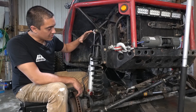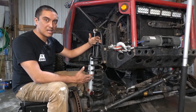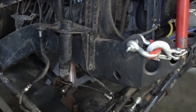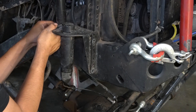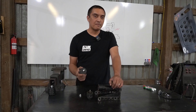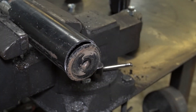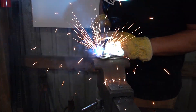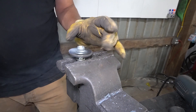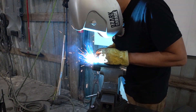We're going to lower the coil mount on the frame. On the front, it's a relatively simple operation because when I built these mounts, I made them adjustable. All you have to do is unbolt this and lower it one bolt hole and it'll actually be one inch lower and raise the vehicle one inch more. If you buy a set of Perry Parts bump stops for your vehicle, you won't have to do this, but my previous bump stops used a five-sixteenths coarse thread bolt into a captive nut in the bump stop tower. The Perry Parts uses a larger bolt — a 10 millimeter — so I'm going to have to cut this off and replace it, but you shouldn't have to do that with yours.